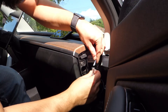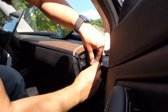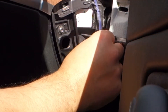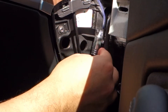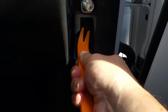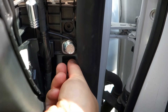There's a bracket over here — run the light through the bracket and then attach it to the light. Remove the plastic security plug so you can remove the side floor panel and run the wire between that and the weather stripping.